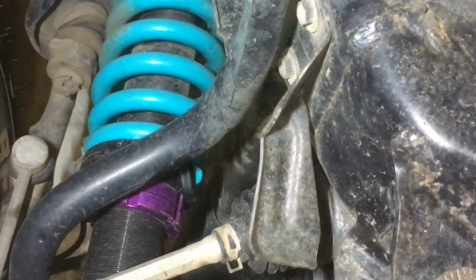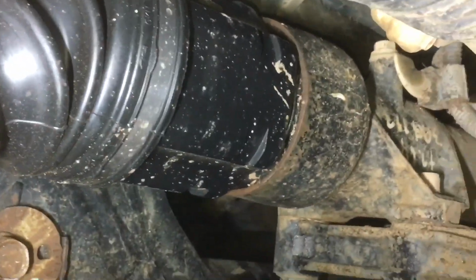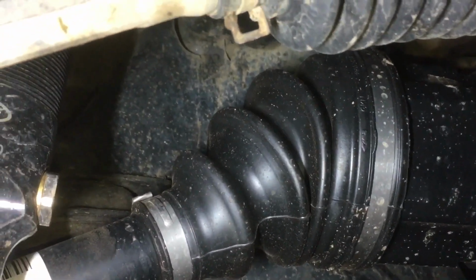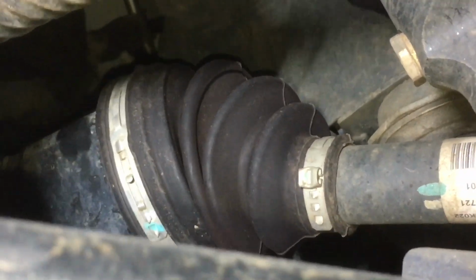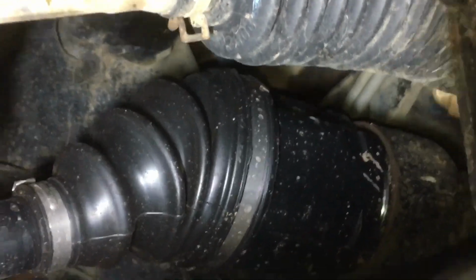It is my belief that if this diff was mounted correctly, and people say, oh, if you don't modify the suspension, it'll be okay. Yeah, I'll agree with that. If you leave it stock standard length and there's no extra travel, you'll probably be okay. But I'm sure we would also agree that you've got 10 mil higher at the diff at this side, because we've seen that evidence, which puts this on more of an angle any day of the week, which actually helps the angle over this side. Which is why, visually, we can go, that looks good, it looks just like a Prado one, beautiful, right? This one, not so good, it's all angled up and all that sort of thing.